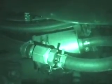Let me see if I can see it here. Yeah, there she is. So I ran that. It's a little ghetto, whatever. It still works. That's not my pump, it's the filter. So it goes from the tank to the filter, up to the pump, then through the regulator, and then to the hard lines and to the engine. It's pretty basic.